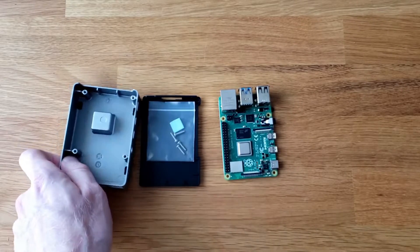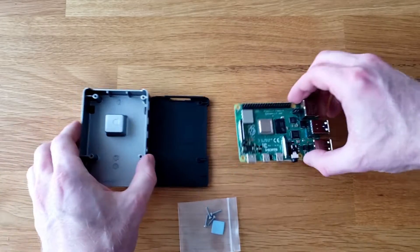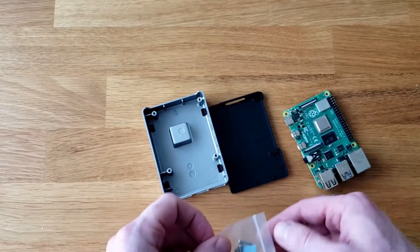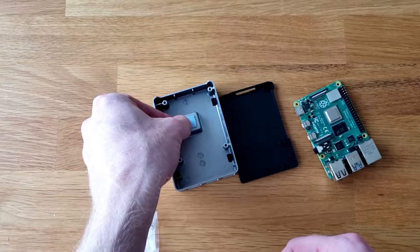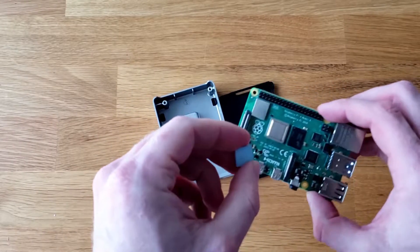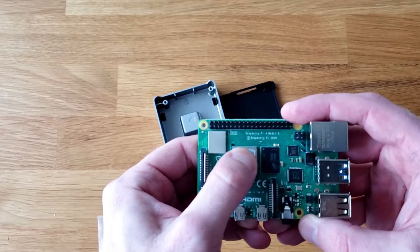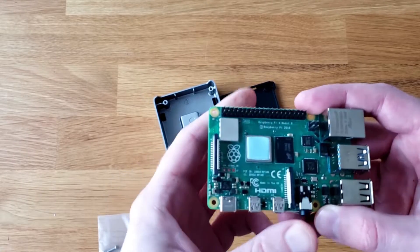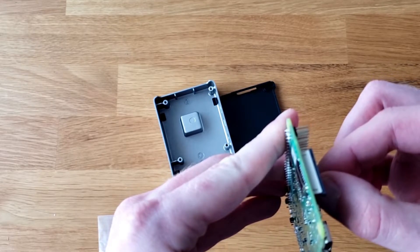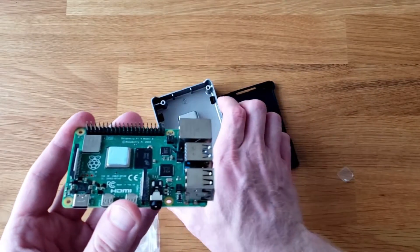Installing the Raspberry Pi in the Flirc Case is relatively simple and straightforward — it's actually gotten a little easier over the years. There is a thermal pad that is included. Some people attach the thermal pad immediately to the post of the Flirc Case, but I recommend attaching it to the Raspberry Pi instead, because the thermal pad is not the full size of the post in the center of the Flirc Case. If you mount the thermal pad to the Flirc Case first, you run the risk of it not making full contact with the CPU on the Raspberry Pi, which may cause cooling issues. So mount that thermal pad to the Raspberry Pi first, then remove the plastic coating on the outside of the thermal pad. Once your thermal pad is mounted on your Raspberry Pi, you can insert it into the Flirc Case.